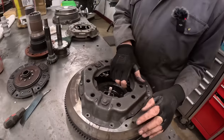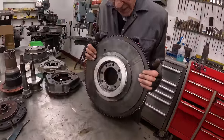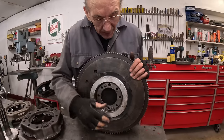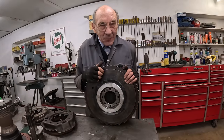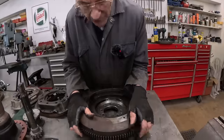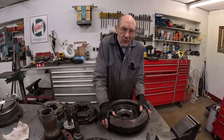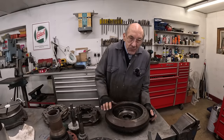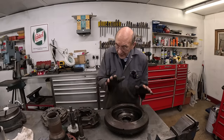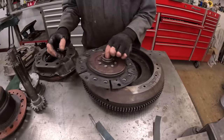So now, we're going to machine that, which means we'll have to take it up the top, but we've got that, which we put on there for driving the dynamo. So whether we can hold it on there, I think that looks a bit iffy, personally. I'm a little bit worried about that, but John will decide what to do. And if not, what we could do, we could put it in the rotary table and then mill it off. Perhaps we ought to take 2 millimetres, 80 thou. So perhaps we could mill it down. So all we need to do is to put it in the lathe and just take a whisker off it. So that might be how we do that. So that's what we're going to do. And then that, which goes on there, like that.